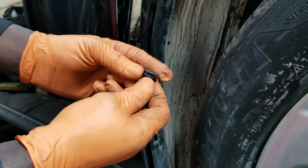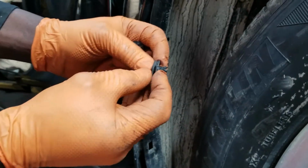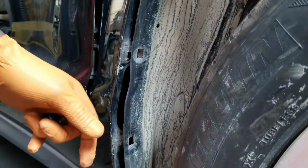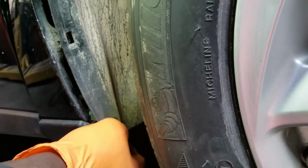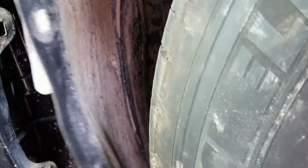This style here, slightly different. You just lift the top off a little bit. It'll be closed up like this. Put a screwdriver in there and lift that up. And then that will pop out. Down here, it's a 10 millimeter. And in the back here, another 10 millimeter. So you take those 2 out, then all of this will be ready to remove.